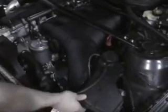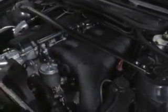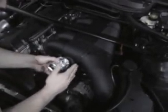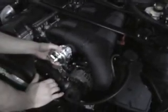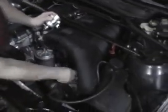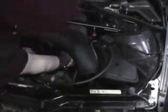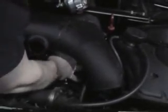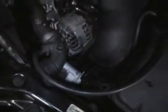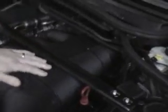Now we're out at the car, and I just wanted to point out a couple of things with fitment. Please excuse some of the mess — the main factor here is just to show you how it fits. First thing you'll notice is the hole right here for the blow-off valve — this is where it's going to go. Normally there's a fan shroud that goes right here; you will maintain that still, so there won't be any overheating problems. The idle air control still hooks up right under here without any problems. You'll notice this goes right down here and meets the intercooler piping, and the oil dipstick is right here, mounted fine. The last thing I wanted to point out is the strut bar — you do have clearance here without a problem. This will not hit.